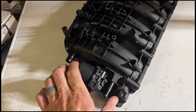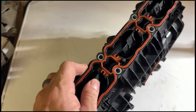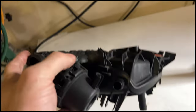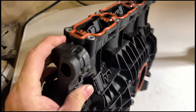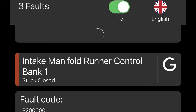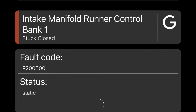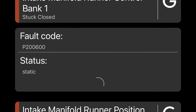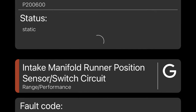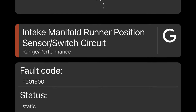I thought I'd share this in case you ever run into this problem. A lot of people are going to say just replace the intake manifold, and honestly that's an easy option, but if you happen to have another one laying around you might be able to steal some parts from it. By the way, this particular code — intake manifold runner stuck closed — doesn't really have any drivability issues until you get to about 3800 RPM, so the car will drive normally at lower RPMs. Just keep your foot out of it until you get it fixed, because it's at the higher RPMs that the runner opens up. Thanks for watching.